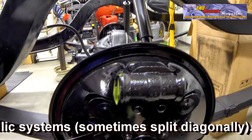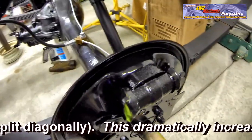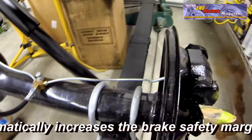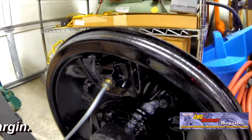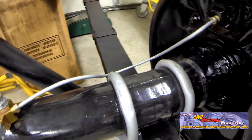The wheel cylinders at the rear axle are more conventional dual piston cylinders. One brake tube feeds the single wheel cylinder at each wheel. Note that the tubing does not rub against any metal objects. Notice the bends in the tubing create enough tension that these tubes will not vibrate.